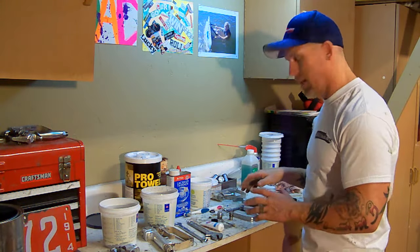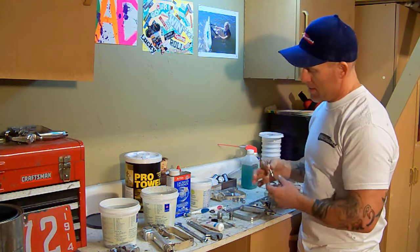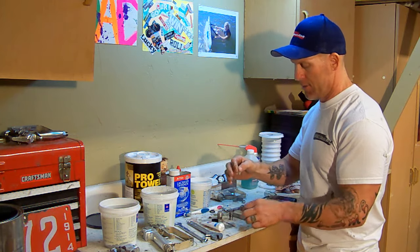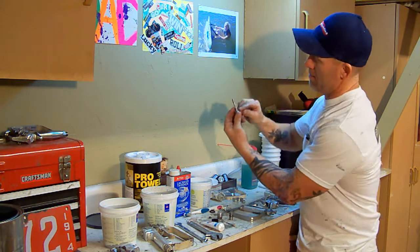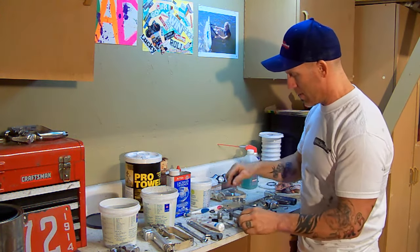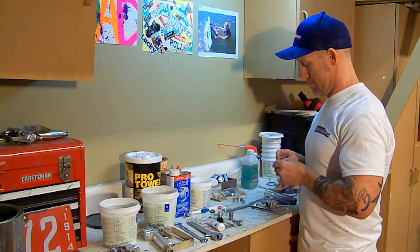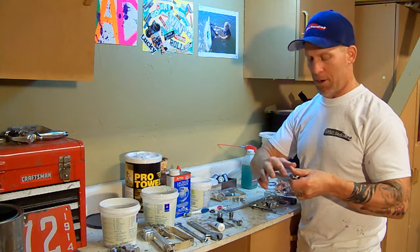After about 30 minutes cleaning in lacquer thinner, we're going to begin the assembly process. I've got the needle and packing right here, and there are three sizes of O-rings. I'm going to put those O-rings back on using a little bit of O-ring lube. I'll lubricate the tiniest O-ring and stick it back on the needle — you can see it sets right down in the little flat spot. The larger O-ring goes on the handle; I'll lubricate that one and stick it back down the handle. The O-ring lube helps you assemble the parts a lot easier.